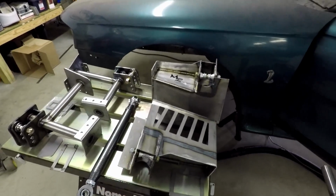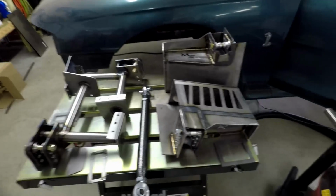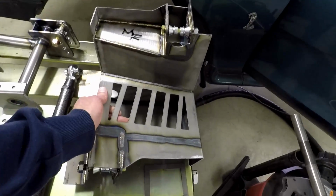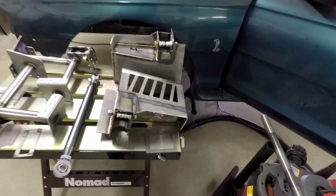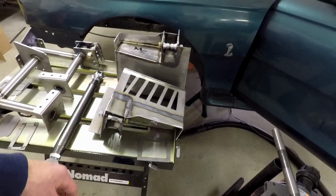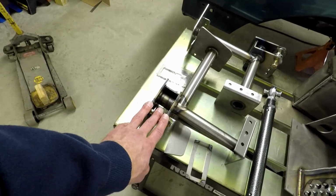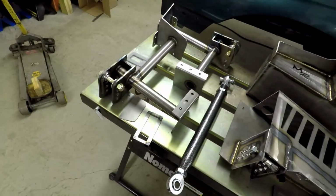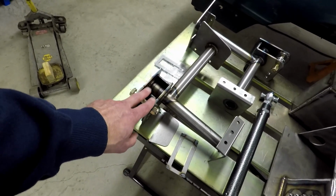We'll get into it. If you're interested, I guess I can go through some differences since they're here. You got more adjustment holes. There's 9 holes. The Team Z's got 4. It is heavier, so if you're crazy about weight, I don't know, you have to look into it, but they are substantial. The lower control arm mount is wider. Of course, these are the race version, so they're narrow. So you would need Heim joints on your lower control arms in order to use these.